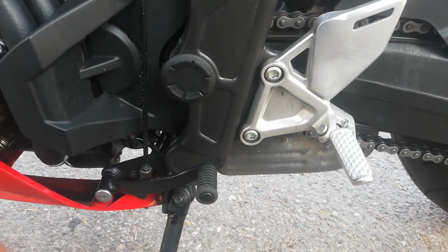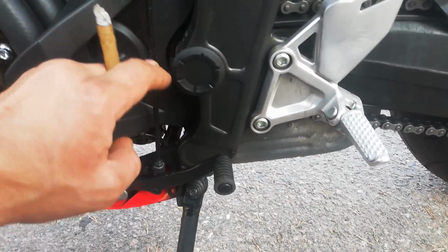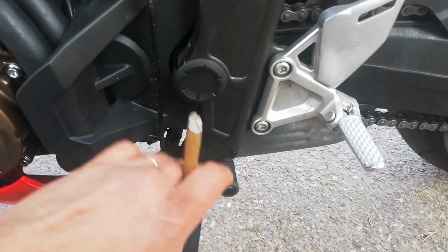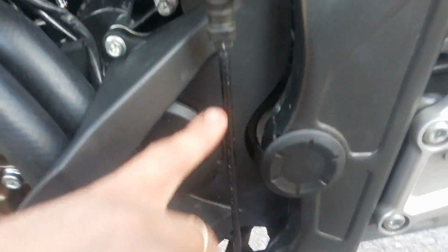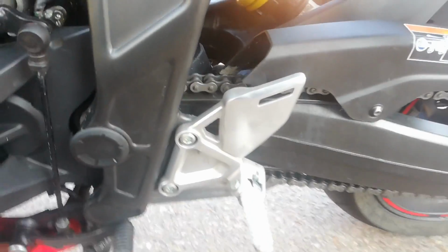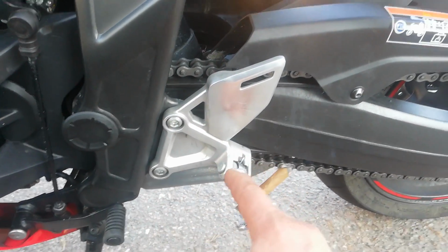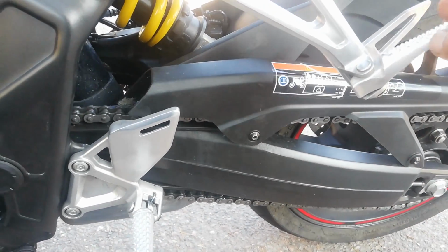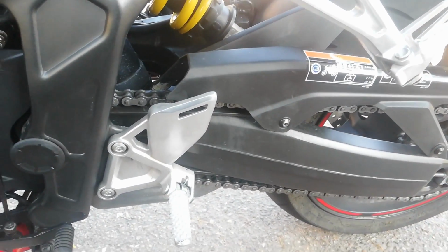Now that I'm actually hanging off the bike in corners and shifting gears during a lap, one thing I noticed is that it was really hard to upshift when leaned over to the right. So, very easy adjustment here, quick to do, helped with that. At one point I thought about moving the pegs a bit rearwards and upwards, but my heels are already pretty close to the passenger foot pegs and I need these more often than not, so not moving them.